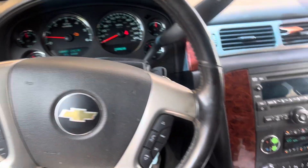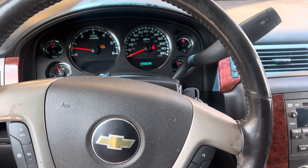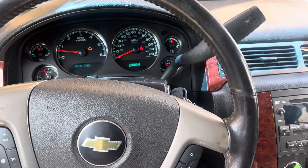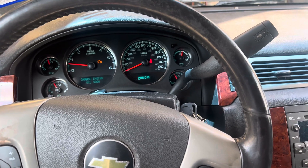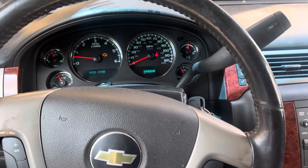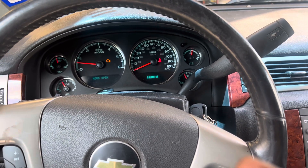Today I'm working on a 2014 Chevy Tahoe 5.3. I replaced the ECM — the engine computer — since the high-speed fans were not kicking in. I replaced it, got it all working good. I programmed it, programmed the VIN, programmed the anti-theft, but we still got a check engine light.